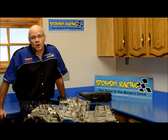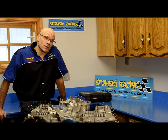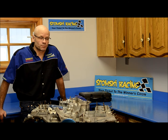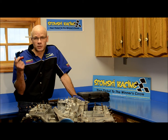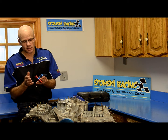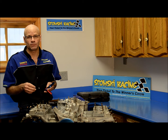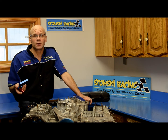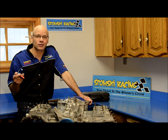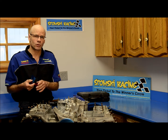The Big Sert is for repairing a job that's either gone really south or is a bigger problem than you originally encountered with a standard TimeSert kit. Our kits allow you to effectuate a proper repair when the engine's still in the car, and also when the engine's on a stand. By digitizing the head and cam carrier and CNC machining our jigs, we've been able to very accurately repeat the angles and position of the tools as they interface with the head, so the exact position of the spark plug hole is matched up with the tools each and every time — whether the engine is in the car or on a stand.